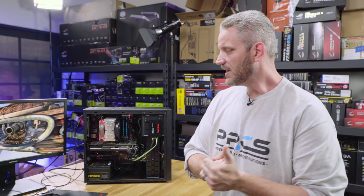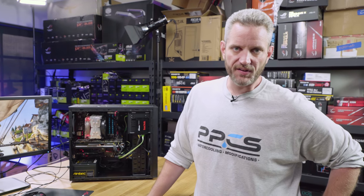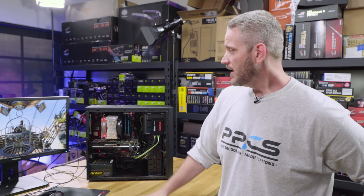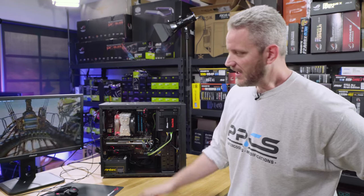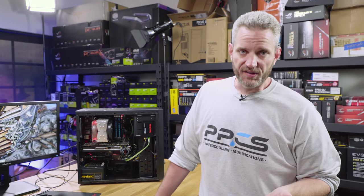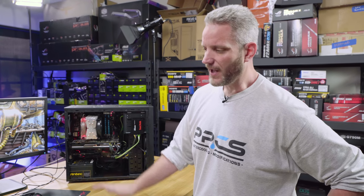The reason I have Heaven running here is because I was trying to put a load on this system. This is a Radeon R9 280X — not the most demanding graphics card, but it's a custom XFX card with an 8-pin and a 6-pin PCIe connector. It's running fine — temperature-wise we're at 62°C, not tripping anything. I don't know if the power supply was actually bad, but once I see that overvolt protection trigger, I'm not comfortable with it anymore. I don't want to take a chance on their computer when I have the ability to swap it out.